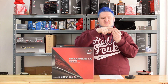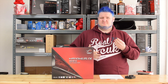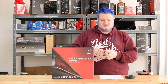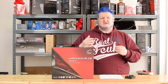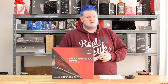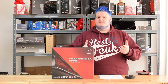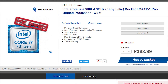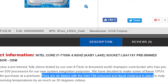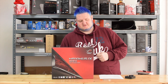If you were to use liquid metal between the IHS and the CPU cooler as well, you'd get an even better average temperature. I did want to do that testing but ran out of liquid metal. Also, you can go to Overclockers UK and buy pre-delidded chips — they've already used liquid metal and sealed it for you. Those chips operate better and generally give a little more headroom for overclocking as well, which is fantastic.